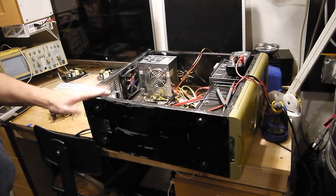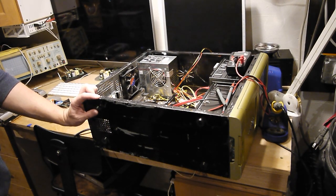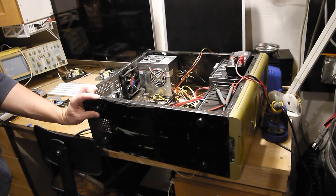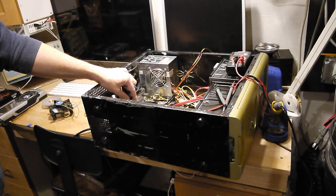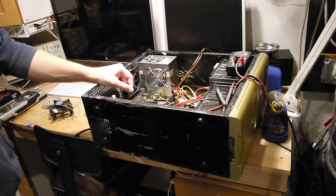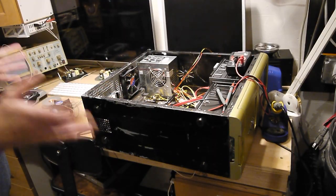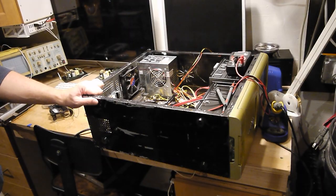He had a little bit of trouble with it. He was going to put in a new video card, trying a few different ones, and it stopped turning on. That ended up just being the clock battery being dead. I've temporarily got a CR2016 in there — it fits, I just don't have any CR2032s. In doing that, I found out we can't run a newer video card because the power supply doesn't have the right power connector.